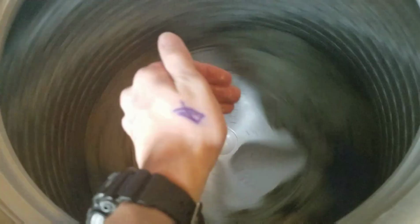The nice thing about spray rinse is, once it's in the spin, it's instantly in the spin. There's no using time to speed up, it's already at a certain speed. So it starts off at, let's just say this is 200 RPM, I don't know what the actual speed is. It starts off the spin speed at 200 RPM, instead of starting it from zero. So you get a little bit better of a spin. Of course, it has to wait the same amount of time before gearing up and speeding up to really fast speeds. But you're still getting longer amounts of spin.